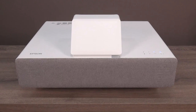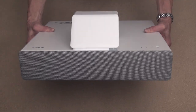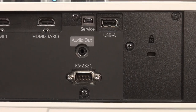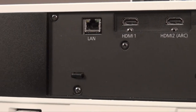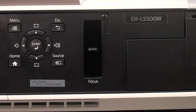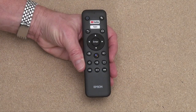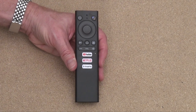Let's take a quick look at the projector. Epson's LS500 is a little less wide than some competitors' USTs and it has an unusual periscope lens that I'll talk more about in a minute. The back of the projector facing the screen has the connection panel with a pair of HDMI ports. The front grille comes off to expose a control pad, focus lever, and an HDMI compartment where you can hide the included streaming stick. You get a compact, non-backlit remote, and there's an extra remote that's just for the stick if you ever move it to another display.